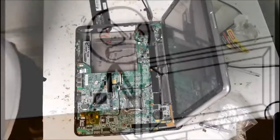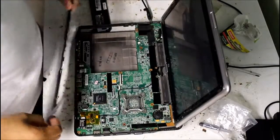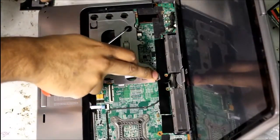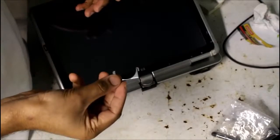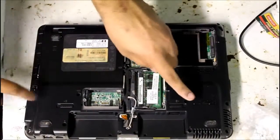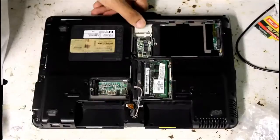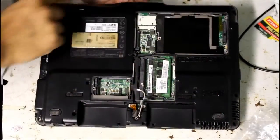It cut off itself. I'm going to go ahead and start closing up the panels on this laptop. I'm going to plug in the touch pad, a couple more screws over here, and two for the screen. Put in the keyboard here, connect the connector at the back. On the back, the two long screws are for the keyboard — it goes here and here. I'm going to go ahead and replace all of these screws around the border here.